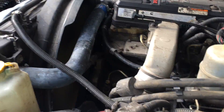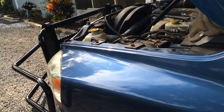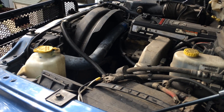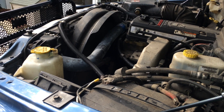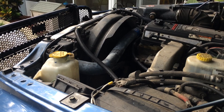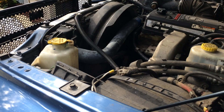You don't have to worry about cutting wires crossing deep water or replacing expensive electric fan components. It's basically $100 for the fan and $50 for the clutch, and it works as good as stock — even with the Ford parts. So if you're tired of replacing cut fan clutch wires, get a 99 V10 fan clutch and a 2003 Ford Power Stroke fan, bolt them up, and it works perfectly.